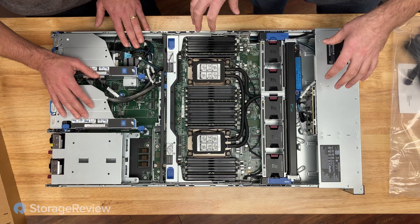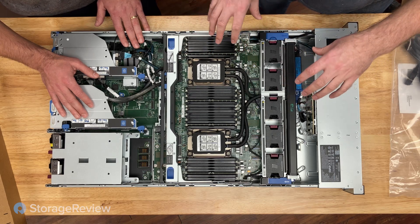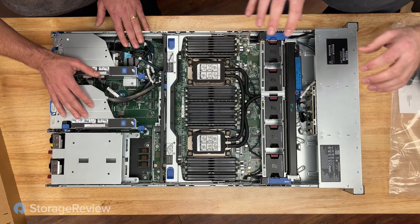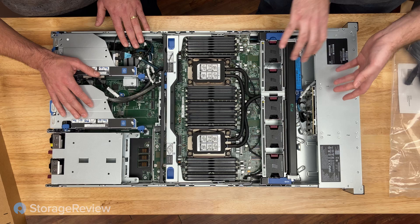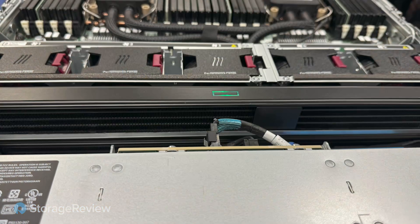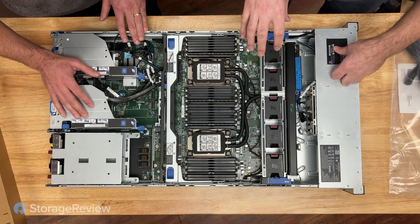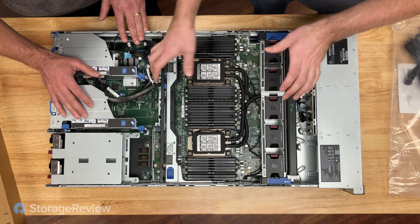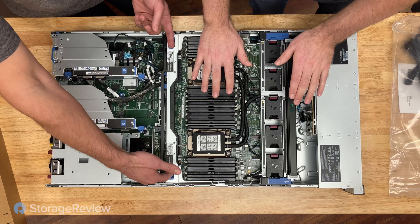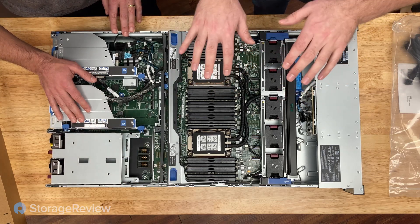Overall it's a pretty unique layout. Because this is a quad CPU layout, it's mirrored on the bottom side. From the side angle you can see it's actually two radiators — it looks like one piece from the top but it's two short radiators about an inch tall stacked one on top of another. To service this, you undo and open this shelf, remove a little bracket, and then the radiator and liquid loop for the two top CPUs can come out as one unit.